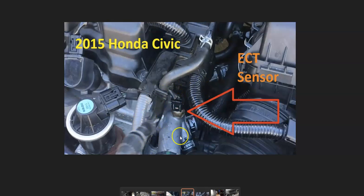After you locate the engine coolant temperature sensors, check out all the wiring. Be sure the wiring all looks good and be sure it's plugged in, because bad wiring can cause the same symptoms as a bad sensor. You're going to want to make sure there are no open shorts or anything like that, and that all the pins are good in the harness.